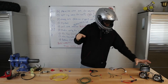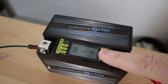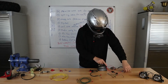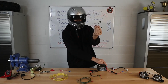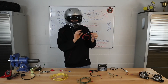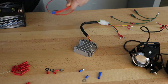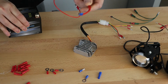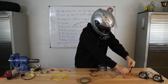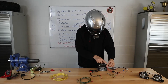Your power is going out to two different places, but the first thing it hooks up to is your battery. This particular battery is a YTX-BS gel-type battery — it has diagnostics directly on the battery itself. We're going to be running our hot and ground, red and green. The red is going to have an inline fuse — I'm using a 15 amp. The blue eyelet connector is going to connect directly onto your battery, bolting right on, and it comes right off of your regulator rectifier.